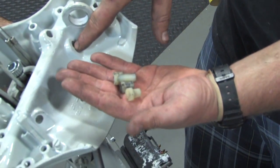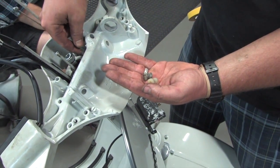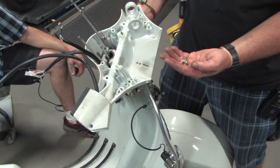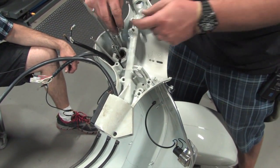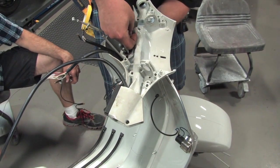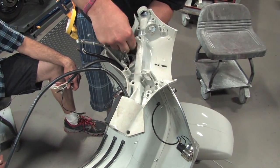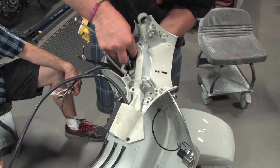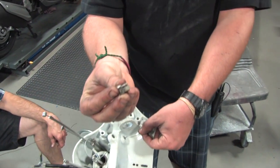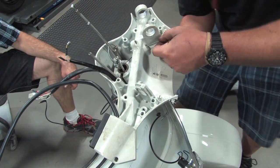There are two different styles of cable seats. Two are the same — those are for the lower selector cable and the throttle side. This special one is the upper selector cable seat. These basically fit in specific bores on the P-series engines. The best way to do these: leave the inner cable in and pass the housing through the correct passageways in the handlebar as a guide. There's a little slot in the seat, so pass that slot around the cable, then use the housing to pull this thing all the way into place.